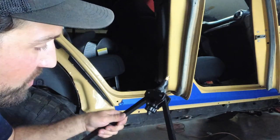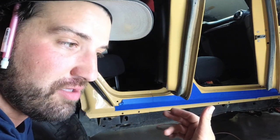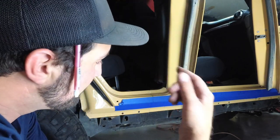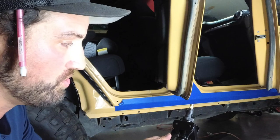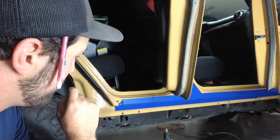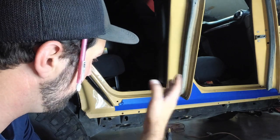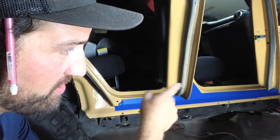You can over-crank it when you're smashing it down and you may see a little dimple or divot in the body of the Jeep — you may want to back it off a little. Once you get that sweet spot where you're no longer making divots, you're good. After we do these first two we're going to put our plate back on there, screw it down in place, zip out all the holes with a quarter inch, then go back with the 25/64ths bit, knock them all out larger, rivet them all, and then mount the plate back up and it's done.